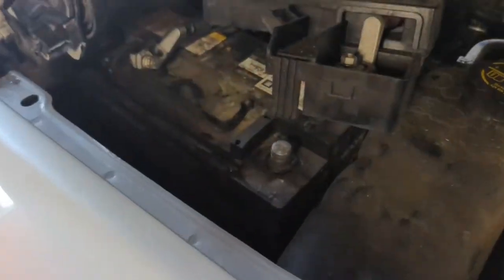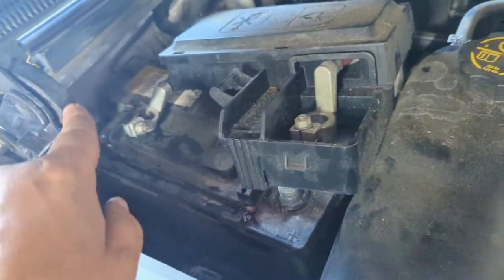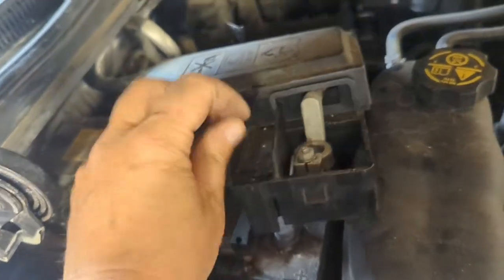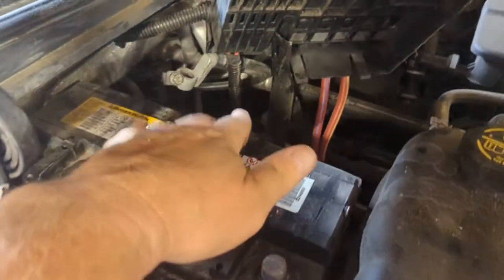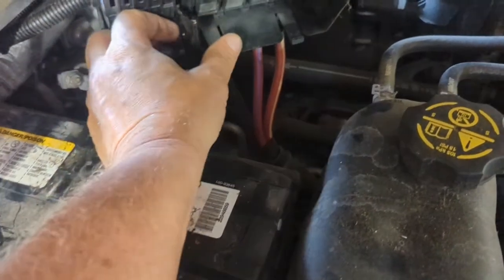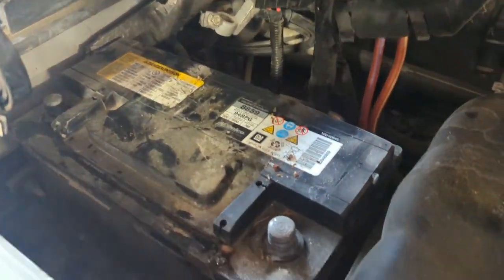Let's get started. 10mm — this tab right here popped right off the side. Super simple. 10mm there. I used a pretty long extension to get back there so I didn't have to deal with this hinge point, and then a shorter extension for that, and it's off. Lots of electronic connections there. I'm gonna use the bar to hold this back. I just lifted this up — there's a gap between the big wires here — and put this underneath, held that there.